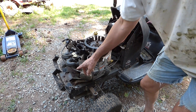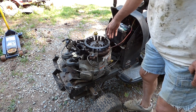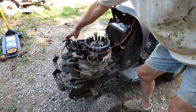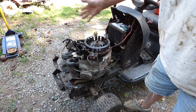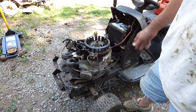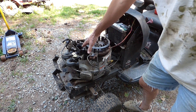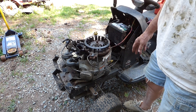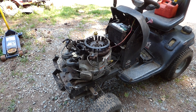The solenoid for the carburetor is all burned up, so I'm going to look for a used one. The fuel line's not connected to the fuel pump, but that doesn't matter because I'll run a new fuel line to it from the other one. I think it's worth giving it a try. I'll change the oil, clean it up, pressure wash it, fix the carburetor — maybe I can make something out of this. It would be nice to have the extra horsepower, too.